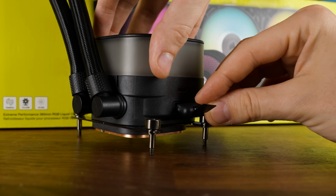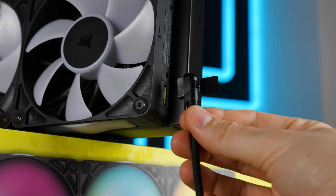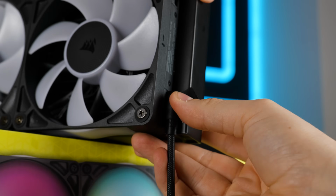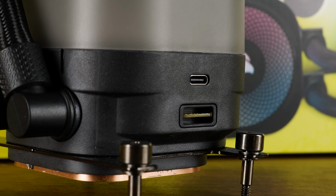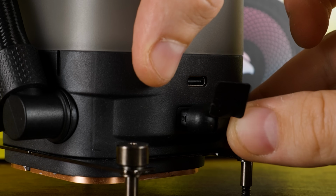Anyway, the first thing that needs to be connected is the pump, and the other one is the fan. And here it doesn't really matter which one, each of them is connected with the other one, so be it the first or the last one, iCUE doesn't care, all the fans are iCUE'd with each other. And please ignore for now this USB Type-C connector on the Waterblock-Pump combo. We will get to that sucker later.